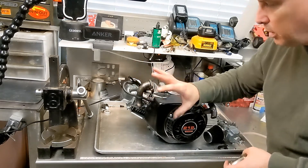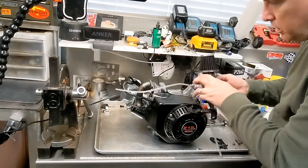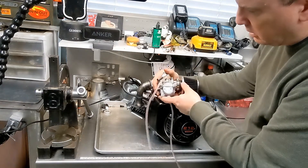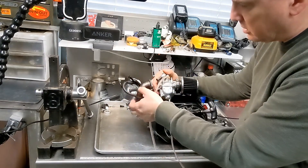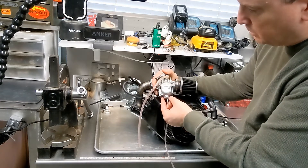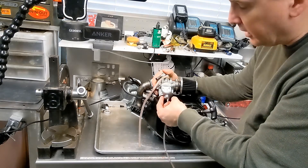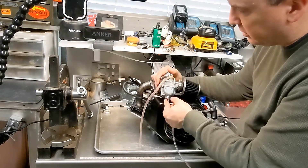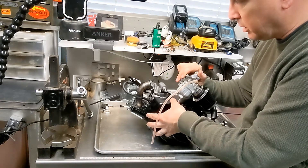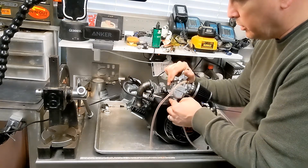I'll post the link in the video. Basically it's going to put the Mikuni over the engine. The problem is the intake is designed for a specific Mikuni that doesn't have this breather manifold on the bottom — it's offset to the side. In this particular situation I've got to cut the airbox cover to allow that to sit in, and that should hopefully do the job.